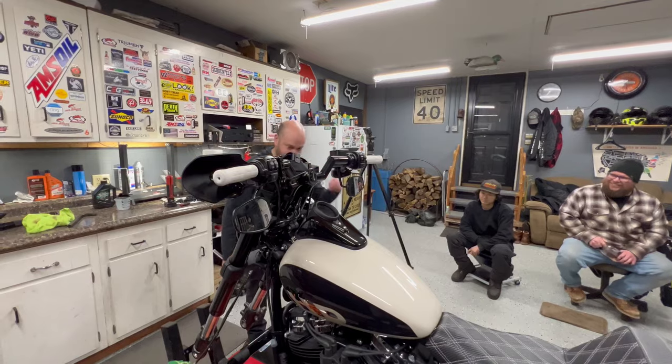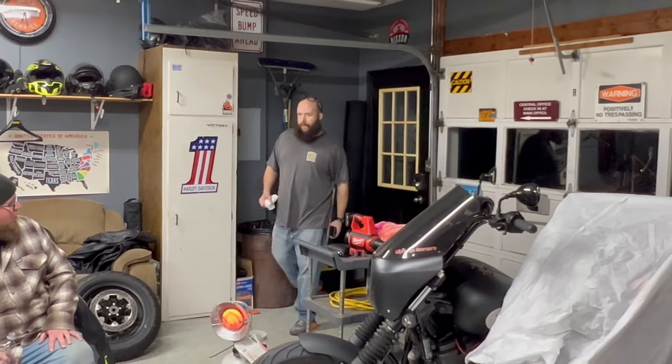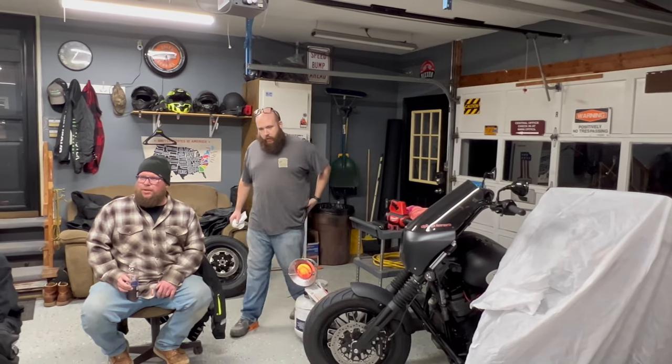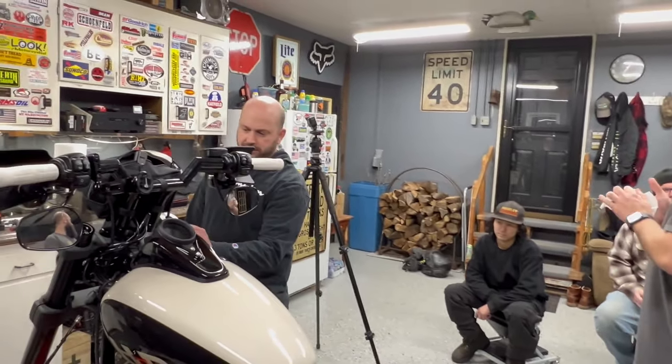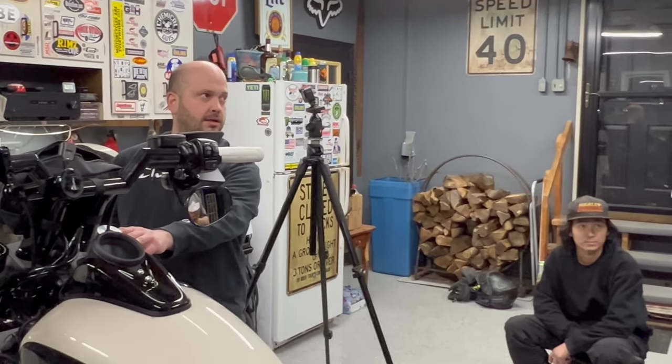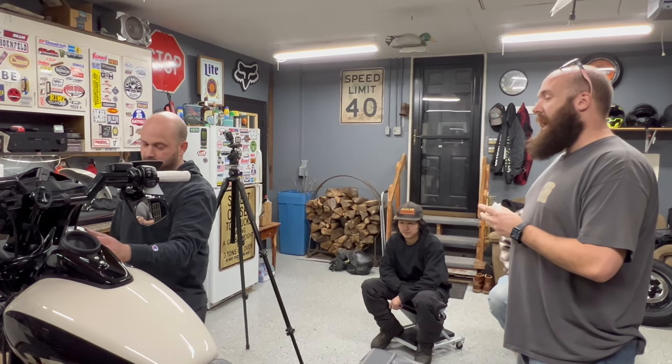You got torque specs yet? 20 foot pounds. No, really? No wonder why they came off so easy. Yeah, fork bolts are not crazy tight. Oh, you found that out. Yeah, there's just a pinch bolt. Paul, I went to 60 on mine one time. Snapped it clean off in the clamp. No kidding. Yeah, don't go crazy.